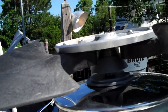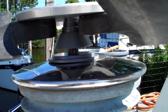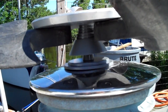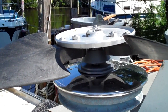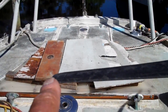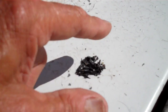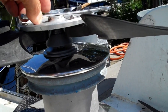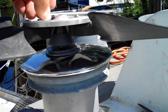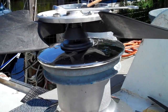They ain't balanced. See this little gizmo down here — that right there is a lawnmower blade balancer, what they call a static balancer. The hub is sitting on that little balancer, and what I'm doing is slowly whittling on this blade right here. You can see I've cut the tip off a little bit — that's the amount right there, not a whole lot, maybe not even a gram. I'm just whittling on it real slow. The reason I know it's on the heavy side is because if I take this wrench and put it on this side over here and move it slowly a little bit at a time, she will balance out.